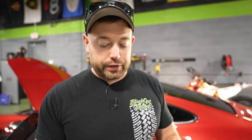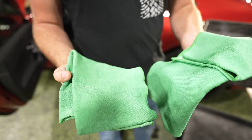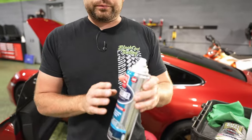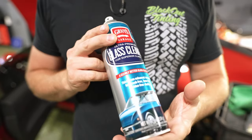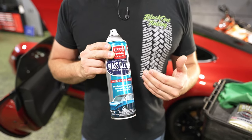The safe way to clean your tinted windows is very simple. You're going to use a glass cleaning rag just like this one — these are lint-free completely. We actually use these when we're tinting to clean our squeegees too, so they really don't leave anything behind. And an ammonia-free glass cleaner — something like this from Griot's Garage is going to be your best bet. This is an alcohol-based cleaner, not ammonia.